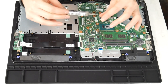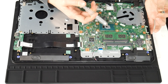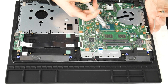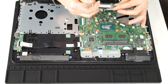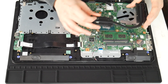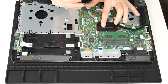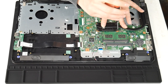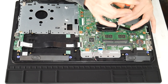The next thing I'm going to do is use some thermal paste on the CPU. I forgot to clean off the CPU before doing this, but I do recommend that. As you can see, it's dried out and there isn't much on there, so I go ahead and put some new thermal paste. I've included a link down below with some good quality thermal paste, because not all thermal paste is created equal — you've got to get the good quality stuff. Then put your heat sink back on. There are four screws and it's kind of like putting a tire on — you go one screw and then across to the other screw at an angle so you don't get one side tighter than the other.